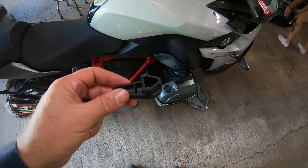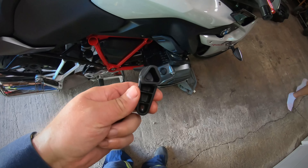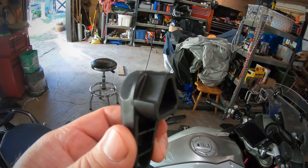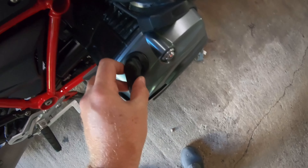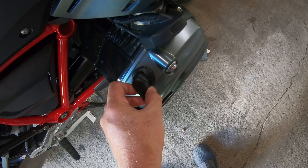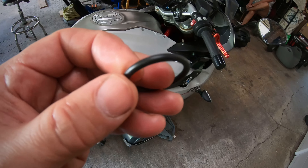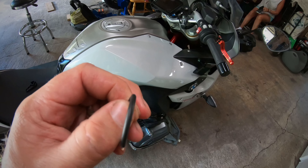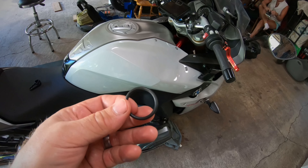There's a bit of dirt. This is a special little tool that BMW likes to make people have — you get it originally with your bike. We bought another one because somehow we lost it; you can get it super cheap. It fits into this piece here and undoes your oil fill cap. Here's the o-ring that goes inside there. I always just look at them — this one you can see it has no cracks, it's not dry, it's still malleable, it's totally functional and it's holding pressure.